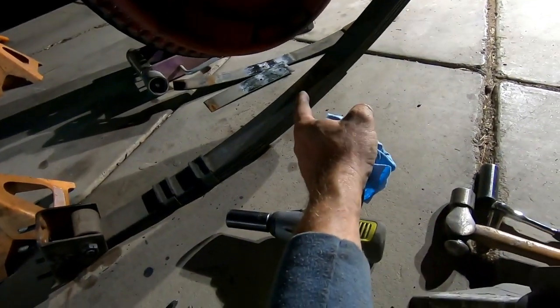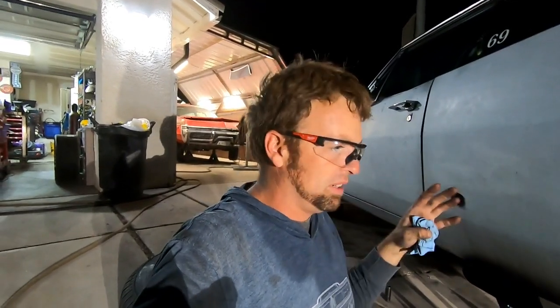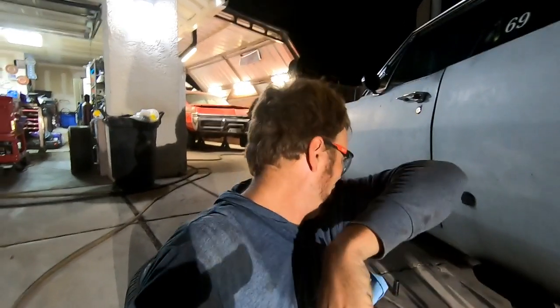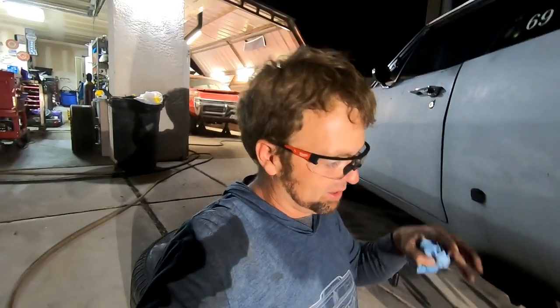I'm putting a 2-degree leaf spring shim on there, not to lower it, but because when I'm lifting the front of this leaf spring, that's taking pinion angle out of the rear end. So by putting a 2-degree shim in, that's probably going to give me back to where I was before. I don't know where I was before. I should have measured it, but it'll bring it at least better, from being negative back to maybe neutral or a couple of degrees down. With leaf springs, you want at least 4 or 5 degrees downhill to get that good forward drive.